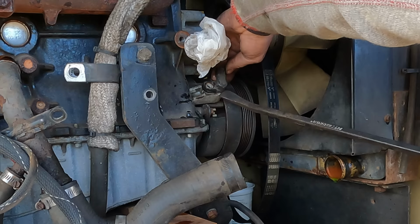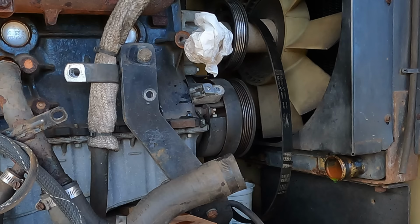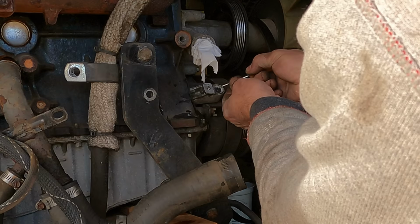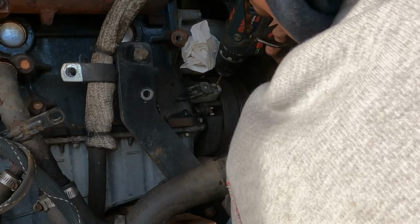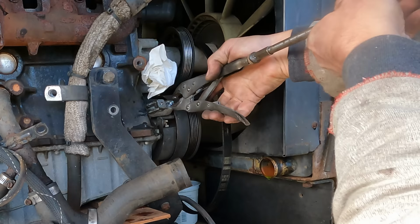That thing might be breaking. Snapped it off. Man, that's gonna be fun. So this is basically a piece of metal going right down the center that's encased in epoxy. So when you try to drill it down the center, the drill bit wanders off to the side. And I tried for some time. I finally got a screw in it and grabbed it with the slide hammer.